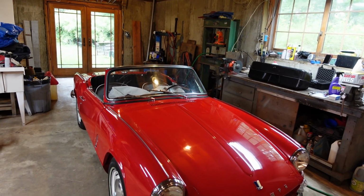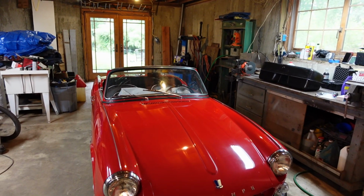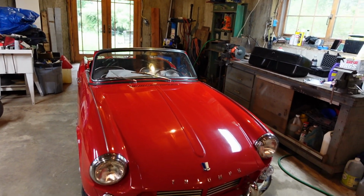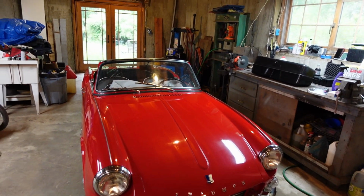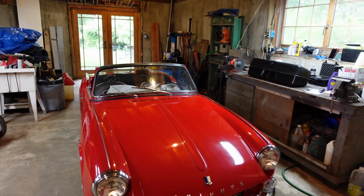I forgot it. But I had a spare fuel filter, so I was able to replace that, let the fuel flow a little bit until I got clean fuel out, and then essentially drove it right here. It's only about 6 or 8 miles away from the house, so I don't expect that the fuel filter that's in it right now is clogged at all, or if it is, it'll be minor.